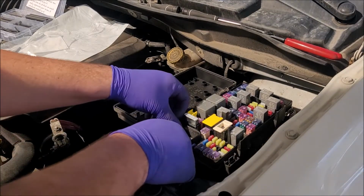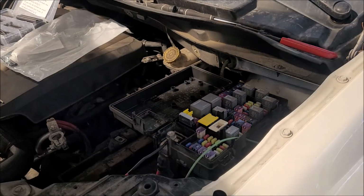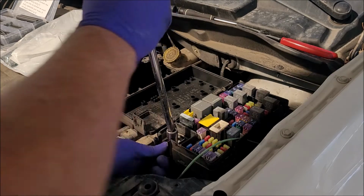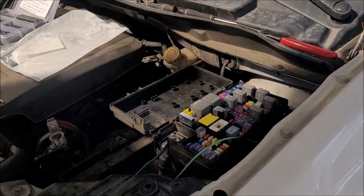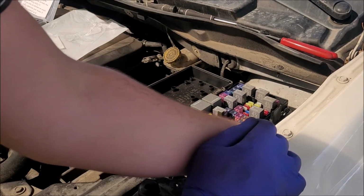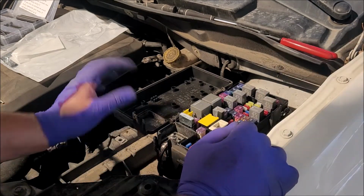Fused lead on right there, maybe there. All right, my eyelet's a little snug, so you can stick it down with that guy and go on. Snug it down. Tuck our wires kind of up here, out of the way. I guess I could probably cut all of those just a tit shorter, but we don't know what we're going to be working with. Perfect. That's off to the side. Fuse off to the side. Shouldn't be anything hot that it's coming in contact with.